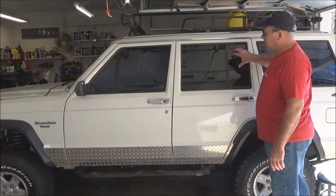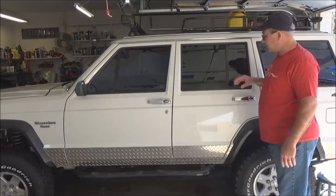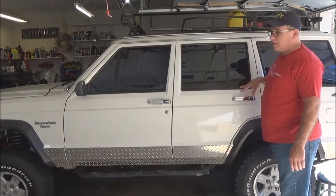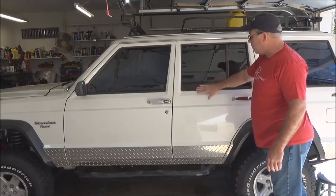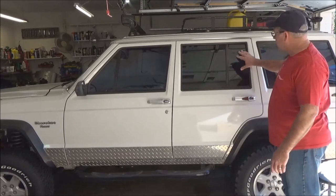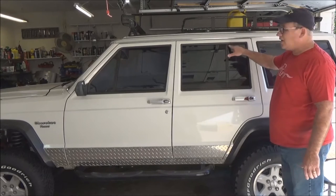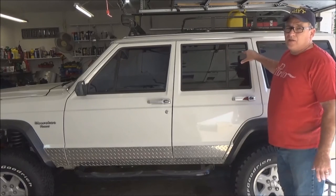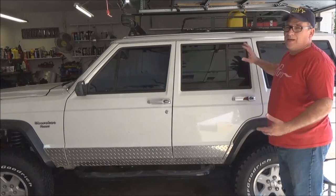But finally, when the 97 came out, it went to very basics. You've got a single piece here that covers the rubber here, covers the rubber here, and replaces that steel piece — it's all one piece. On the quarter window, this was brilliant: this piece is just one piece. There's no separate gasket for the inside and outside, and it is bonded to the quarter window. So it's just all one piece — you don't have to worry about separate pieces.